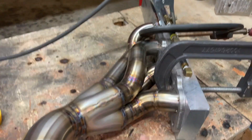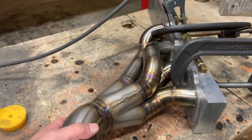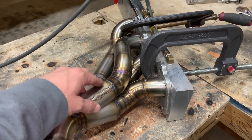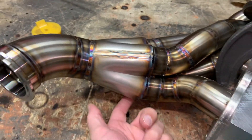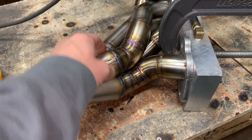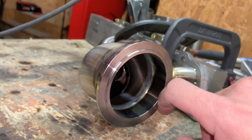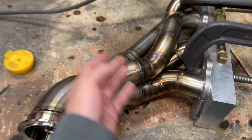What you saw on the time-lapse was me stacking the primaries together. I've jumped way ahead and welded all the primaries out individually on the bench, stacked the primaries back into the car, and this piece was already made up off the hot side. Then I weld these two pipes together right there on the bottom and on the other side — that holds them together. Then I knock the collector back off and finish welding around with the star, and that seals all four pipes into one joint, then weld all the way around — it's sealed up.